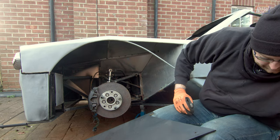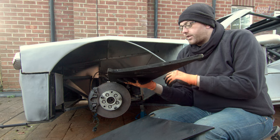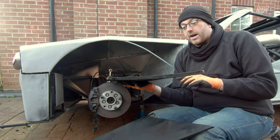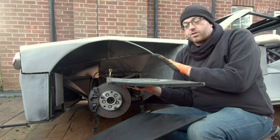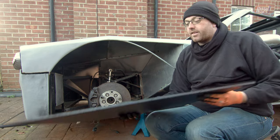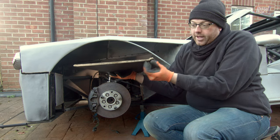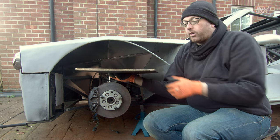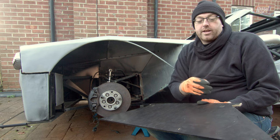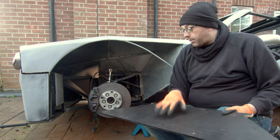This is the previous panel that we had on, and you can see it has warped really badly. This is 12mm marine ply, which was painted and then varnished and then put onto the bottom of the car. That was in summer, and it didn't even survive the rain through summer and autumn before it all started warping — I knew I was going to have to replace it. So that was why I ended up getting a couple of sheets of phenolic ply and recut all of the panels. I'm really pleased to say this has actually survived incredibly well. Where it was left open to the elements, it really hasn't delaminated at all. The spec says it should survive something like four hours in boiling water before the resin starts to break down. And actually, this is perfectly fine.